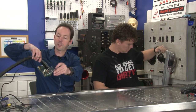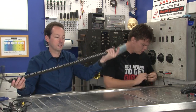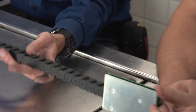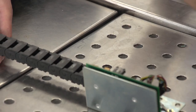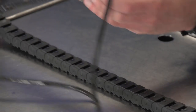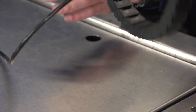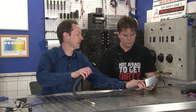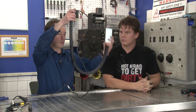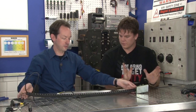This is kind of a cool bonus little find in there. Pretty common in big machines. I believe we've got a heap of that on some of the CNC machines. Yeah, we do. The SR is just covered in it, except it's quite large, way bigger. And this is just a cableway with a caterpillar setup. So this would have been for the robot as it was going up. This would mount somewhere in this, and this part moved. This lets you get wires to the robot that won't get tangled in anything, and it protects them from abrasion and all that.